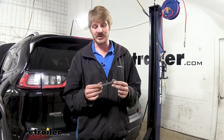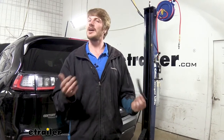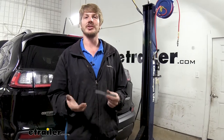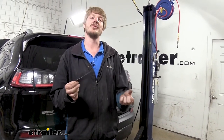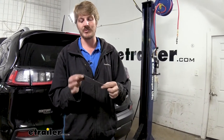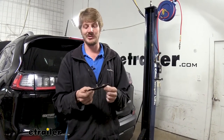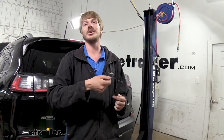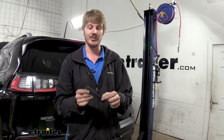You're also going to get a couple other items in your kit. Let's say you go to hook up to your trailer and you've got all your lights but one, and it kind of comes in and out as you're messing with your wiring. Check your grounds. In many cases, your ground is what's causing your components to cut in and out. And a lot of times, it's just corrosion that builds up, or maybe the surface you had put your ground on is a painted surface, and you're not getting a good ground, so you're going to get some emery cloth in there. This is an abrasive material that you can use to just clean that up, and you can also use this to clean off corrosion in other areas. Maybe you got it on your terminals. We showed you the little brush for cleaning out the inside, but maybe that ground on the outside of your connector needs a little bit cleaning up. You can knock those off with this as well.